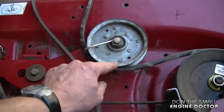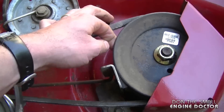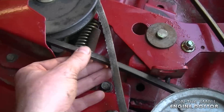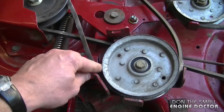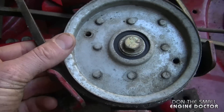The belt will loop around this pulley. The inner part of the belt goes inside this pulley here. It comes out here, goes underneath this pulley here — you can see the belt's on top — works its way around the left pulley, then loops its way back to this pulley here. On this top pulley, it's the back side of the belt that's rubbing on it.